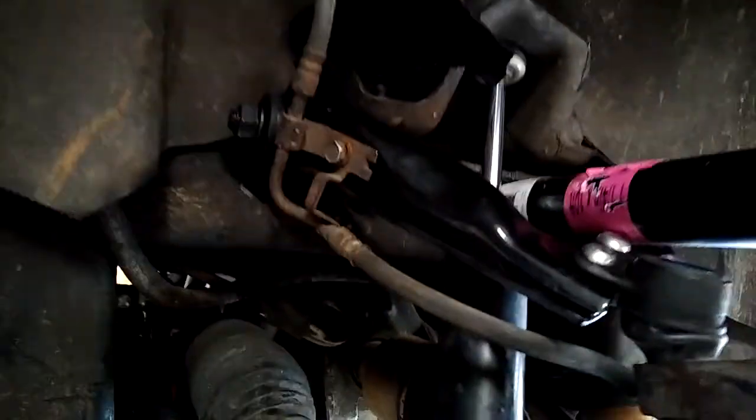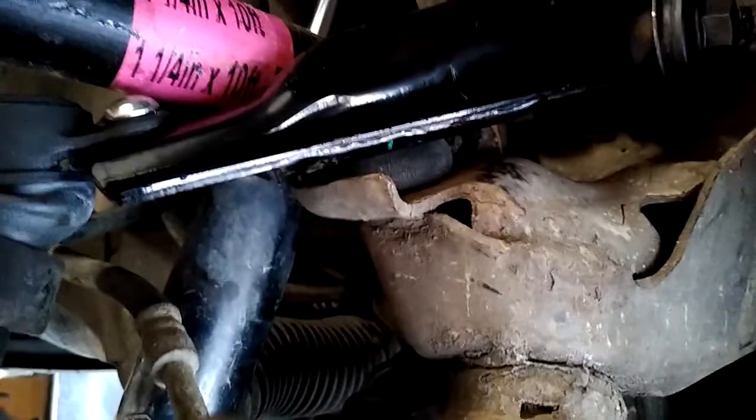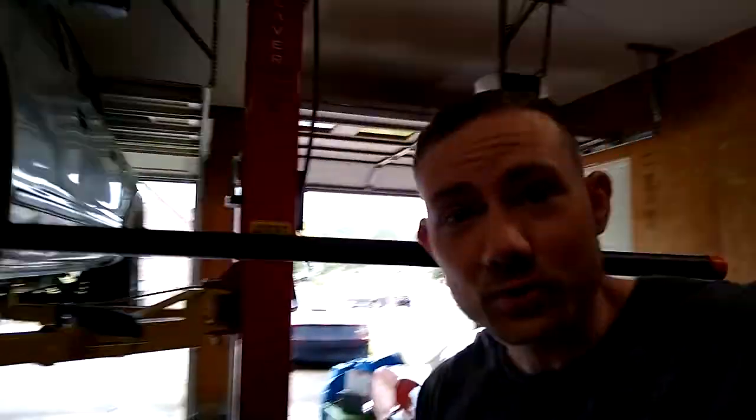Having some know-how comes in handy as well. Like when your biggest pry bar doesn't work, why bother? Go straight to the biggest pry bar. These things you usually have to pry down on them to get the bushings to rotate enough so that you can get that nut in there. Mine also has bump stops that have to get squished as well. Just some little tips and tricks — get a big pry bar if something's not working the way you want it to.